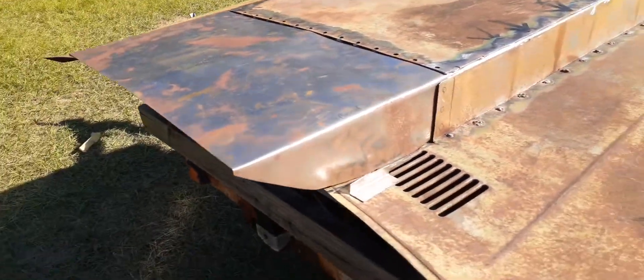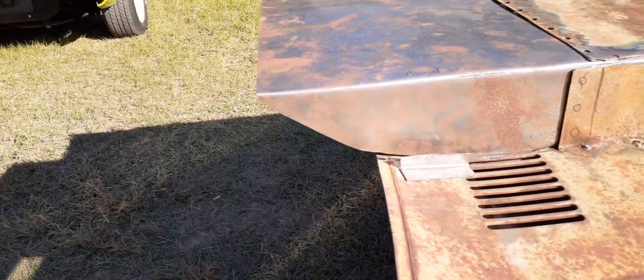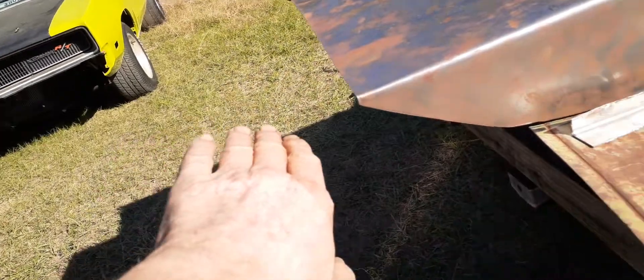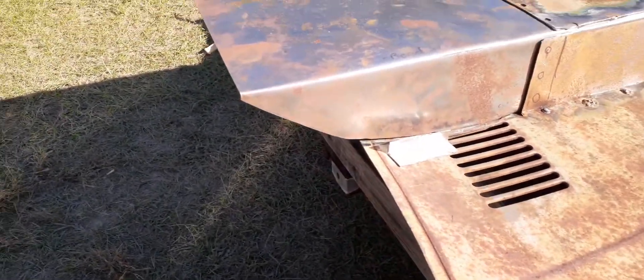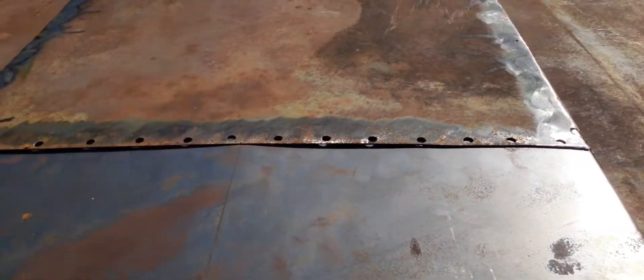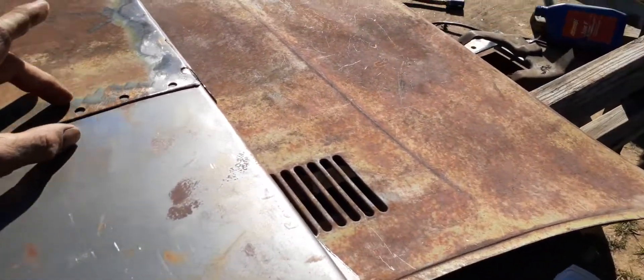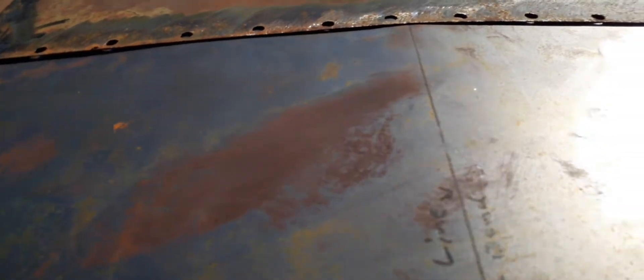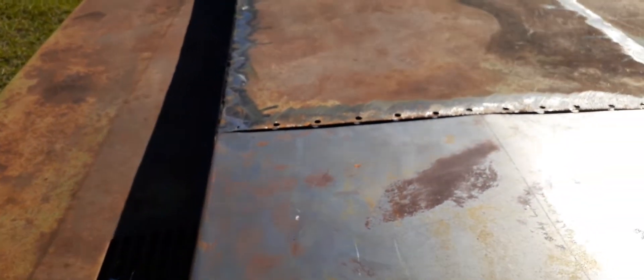That'll fit in just like that and it'll go back up into the windshield, almost up to about two inches level up through here with the windshield coming up through here. I just gotta drill these out and butt weld all this in. I made the line here to match the factory line, and I've got a brace I'm gonna put all the way across the center to pick it up — see how it pulls it up to match the other piece? That's how it'll sit, and then we'll start doing some body work and spraying it on the next video.